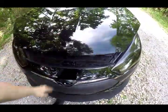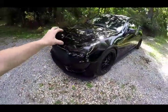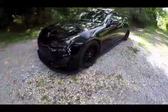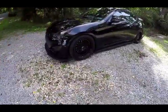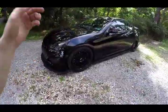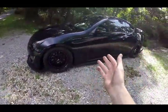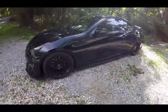If you have any questions you can ask in the comments below — I literally just did this like two days ago. The oil cooler kit itself I paid $525 for, and with a discount code it came out to $510 with free shipping. Then obviously oil on top of that. I used an OEM 2013 2.0 spin-on filter from Hyundai and it fits perfect — it has a little baffle on the bottom of the filter which actually helps out a lot.